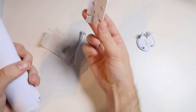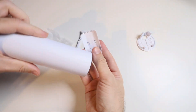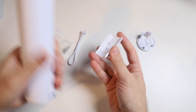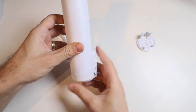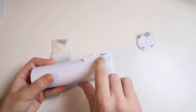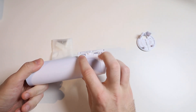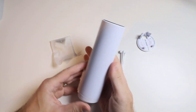This piece here is what we use to mount to the wall or to a pole. For wall mounting we've got two screw holes and we use those to screw this into the wall. We want to make sure this piece is oriented correctly - this bit up, this bit down - then once screwed onto the wall we slot the wireless access point on. The grooves in the bottom of the wall mount base line up perfectly with the tabs on the unit. For pole mounting, we use the two zip ties which run through the two slots in the back of the wall mount piece, around the pole, pulled nice and tight - that's the pole mount system.